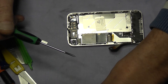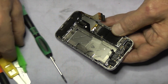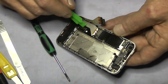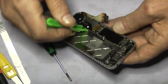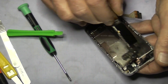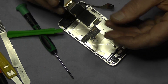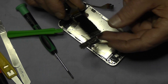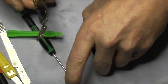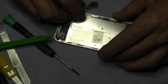The record time for me to change a screen on an iPhone 4 is 25 minutes so far — I don't think I could do it in 20 minutes, 25 minutes was going some. Anyway, we are just lifting up the logic board after checking we have got all the connections off. This one is missing a little rubber bumper — the protector to stop the LCD and the digitizer cable from chafing on the logic board.